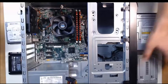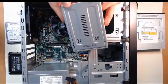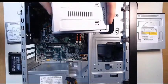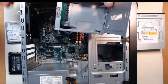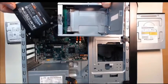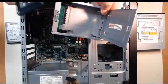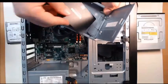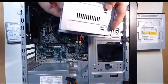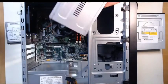Now first we have the hard drive. Now this is an adapter — it's not actually a full hard drive. It's a three and a half inch hard drive adapter. The reason this is important is because people commonly like to purchase these type of drives. These are solid states. They come in a two and a half inch size which is meant for a laptop. With adapters like this, we can easily take a solid state hard drive, drop it into position, and close the lever. Now the two and a half inch drive is in a three and a half inch adapter.